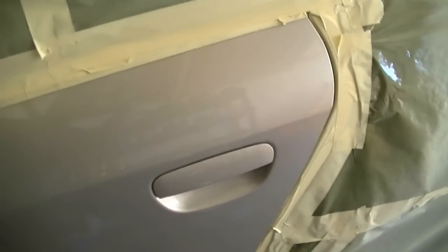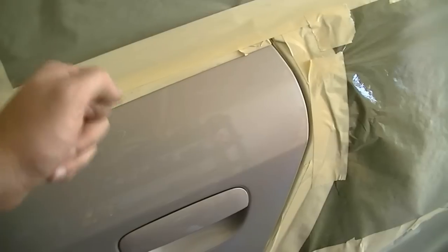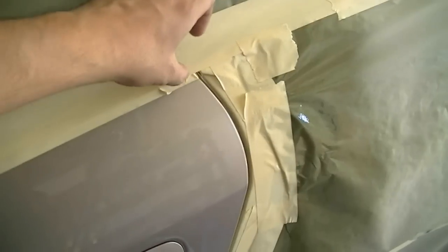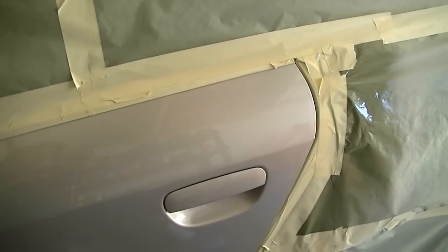But I say to take off the tape after about 3 or 4 hours, because while this is still kind of wet, there's less chance of ruining the paint and taking the clear coat off with it. Or if you wait 24 hours before you take the tape off, you can run razors around all the edges, between the paint and the tape. Make sure they're all separated, so when you go to peel it off, you don't peel off the paint with it. Alright, so I'll see you next when I've taken all the masking tape off and we're ready to start sanding and buffing.